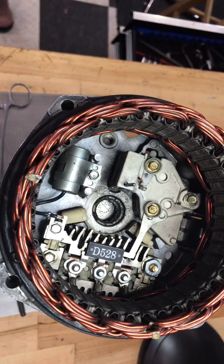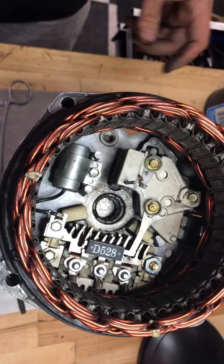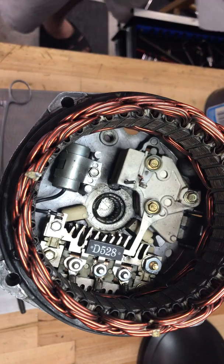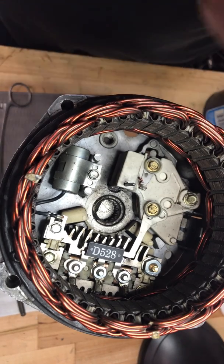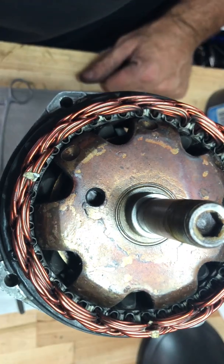Now it's pretty easy — I can just take the armature. Before I do that, put a little dab of grease in these needle bearings. Grab the armature, slowly set it down inside of here, keep it lined up, keep it coming down. It's spinning on the shaft — boom. Pull out the allen wrench, and she's running on the shaft with the brushes running up against the armature.